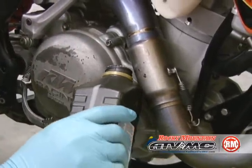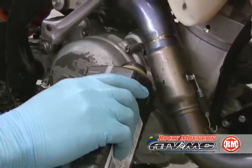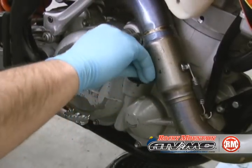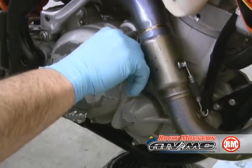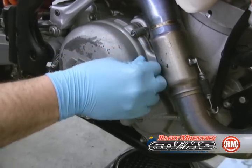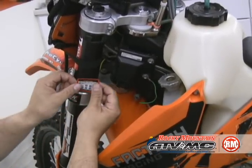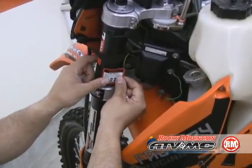After you get all these tightened up, it's time to put oil in. This model takes approximately a liter, which is really close to a quart. Go ahead and fill it up and watch for the oil in the oil window. Start the machine, let it run for a couple minutes, then check your window again. It might be necessary to add a little bit more, especially if you've changed your filters. Tusk oil filters come with a maintenance sticker — go ahead and put that on your bike and you're ready to go.